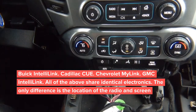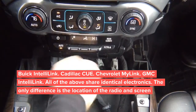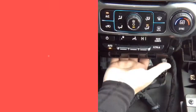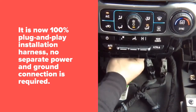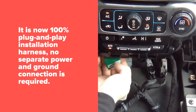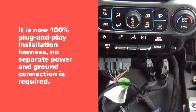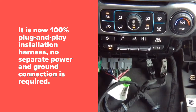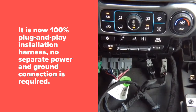Don't worry about any airbag light. The video in motion installation is done behind this panel. Tilt your head down and look inside — you'll see the radio module right in the back. You're going to need two connectors: the main plug and the green connector. The green connector is where you get power — there are only two wires, constant power and ground.